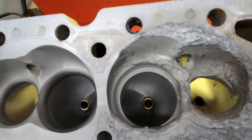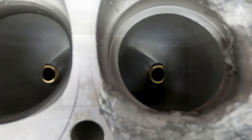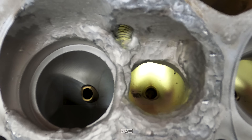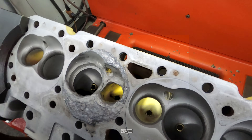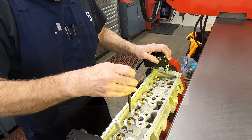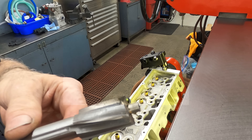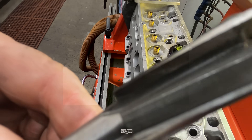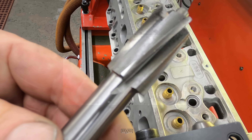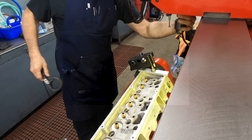The guides — typically when they break valves, it distorts the guide so you can't really drive them back to the valve spring side. What I do is roll around here, roll it back over to the other side, level it up. I've got some spot facers that I use to cut the top of the guide down and drive them back towards the combustion chamber side.